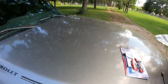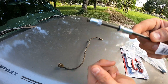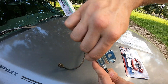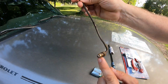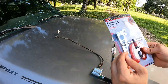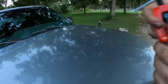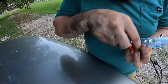I just made the trip to O'Reilly's. Here's a short piece of brake line with two fittings on it — this is a factory right-hand-side Ford Explorer brake line. This will thread in here, and this is the factory Volvo line with the factory metric end. We're going to take the old end off, put one of these on each end of the Volvo line — left and right side — use the flare tool, flare it, and then connect to the factory Ford brake lines. We got the little bracket zip-tied to the rear end, cut the old end off, put the new one on, and we're going to try to flare it. I've never done this before. It was definitely flared.